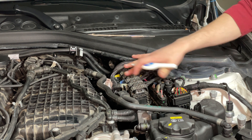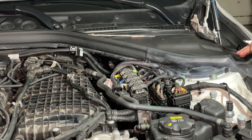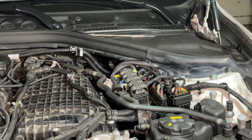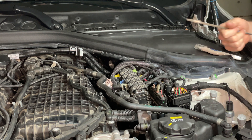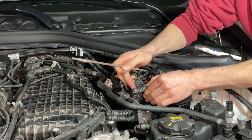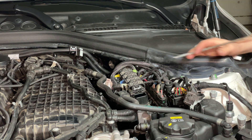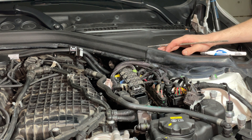Here is your DME — tons of connectors. It's always a good idea to take an actual photo of where these connectors are all lined up. I already have my first one color-coded and I'm just going to do a second layer on that, which lets me know that it goes in the first pin location. So this is your first connector on the DME. You want to find this little pin — you might be able to use your fingers — put that in, slide it forward, and it actually brings up the connector. You're going to want to go ahead and do that for all of them.